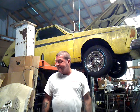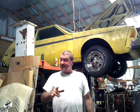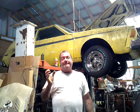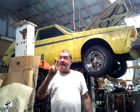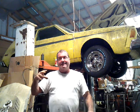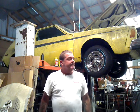But we're gonna put a fuel pump in. I can't get an original. My goal was to keep this thing looking original, and it's gonna look original because this one's going in the back. I was getting ready to buy one of those little clickety-clackety small-time pumps for $75, $80. But I happen to have two Holley electric fuel pumps that come with a little regulator, which helps things line up when you run fuel line and keeps it from vapor locking, which is great.